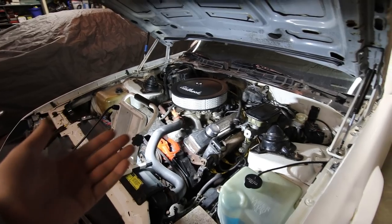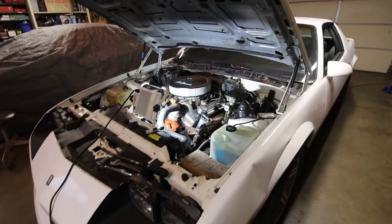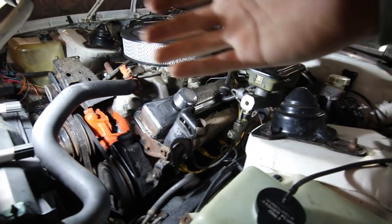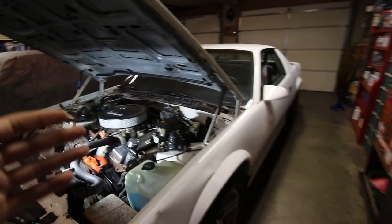It can't be the fluid. I didn't really do anything else underneath the car other than install the new bushing. So what I'm going to do is take the plate out from under the car, and hopefully it's going to take care of the vibration. If not, I may just switch back to a factory replacement rubber mount, which is another common fix to that. They're going to absorb a lot more vibration from the driveline than a polyurethane one will.